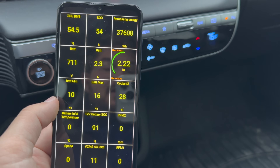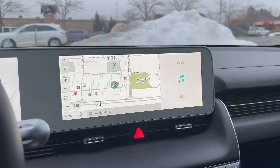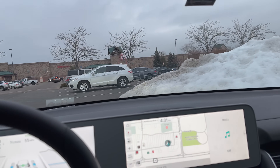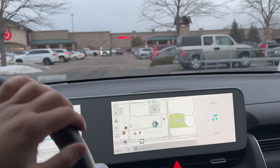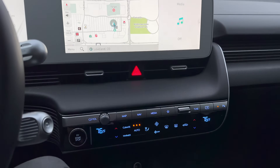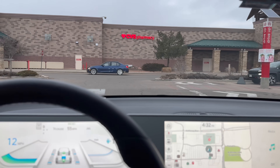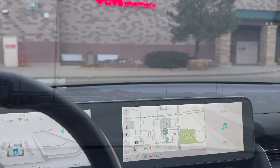What I'm going to do is drive around some more — I'll reselect the charging station and keep driving, then plug in and see what charging speeds we get. I'm not yo-yoing the car; I'm driving completely normally. I've done this many times with the Ioniq 5 where when you don't precondition, it gets the worst charging speeds ever. I'm purposefully driving gently to not artificially heat up the battery pack with my driving.